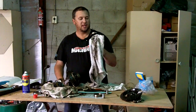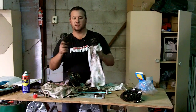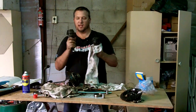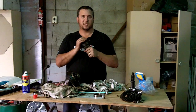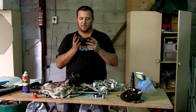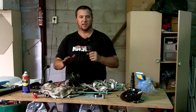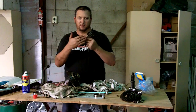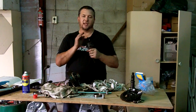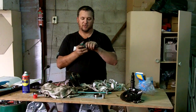Okay, so we've got the 308 geared pinion out, and you can note that it's a fair bit bigger than the 389 one. Okay, so I should probably stress again that this isn't something you should do at home. Putting a pinion gear in and setting up the lash and the tooth engagement and the preload on the bearings and that sort of thing, it's something that you need some specific tools for, right?